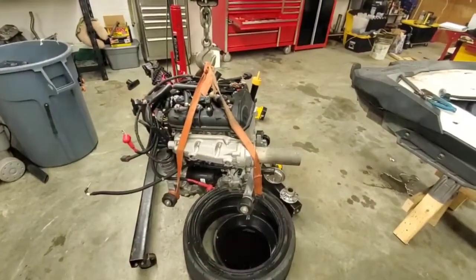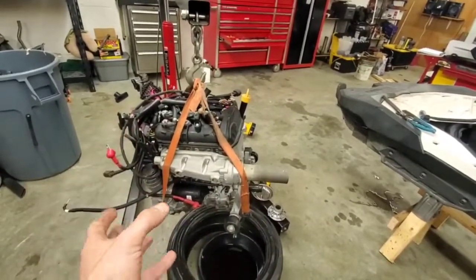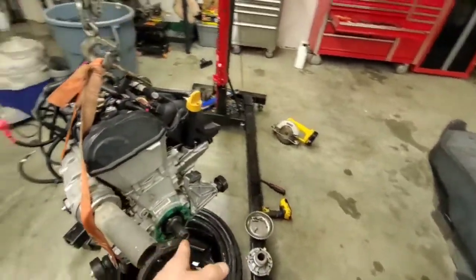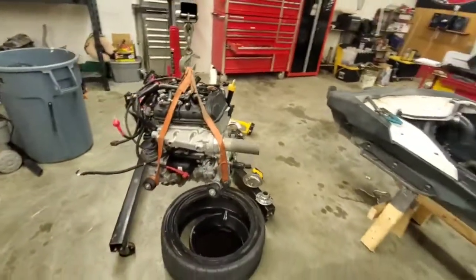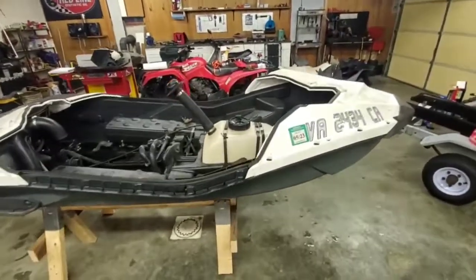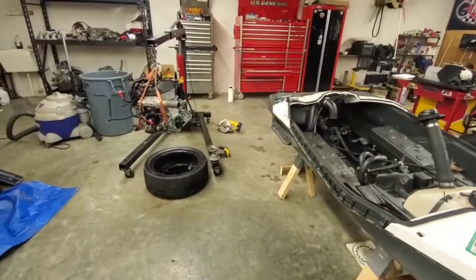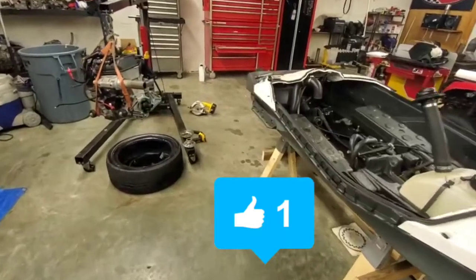I know this has probably been through three winters, so I want to make sure that if there was any water inside the block, nothing had frozen and hurt anything. I'll be able to check the cylinder walls and might do a leak-down test on the cylinders to make sure the rings are good. But I've already put a pipe wrench on it and the motor has awesome compression, so I don't feel like anything's bad. I'll shoot another video as things go on — anybody who owns one of these, I feel bad for you. But I bought mine knowing the problem, I'm going to fix it the right way, and I'll take you along the journey so anybody else doesn't have to go through the pile of information I'm having to dig through. Stay tuned, thanks for watching.